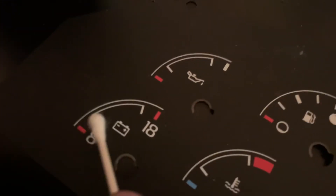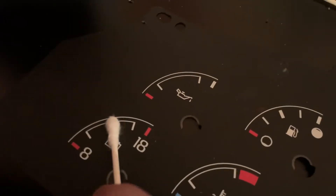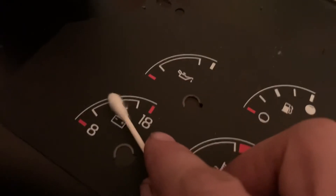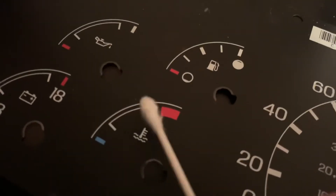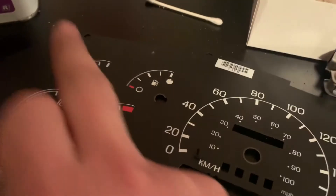Mark where your tank is at. The voltage gauge, when you go to key on, should sit kind of below center, and then when it starts up it should be roughly in the center — just lets you know you have voltage. When you key it off it will come back down to the bottom. Note where it is. Then take two spoons and basically pry the needle up very gently in order to pop it off the shaft. Then you can heat this up and pry it off.